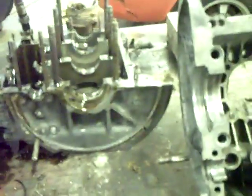Okay, we took the engine out. The engine was very difficult to disassemble. It had been together for so long that the heads were seized to the cylinders, or as we call them around here on Sand Mountain, jugs. But this is the cylinder that gave me so much trouble. This was number 3 cylinder, and as you can see, we had to beat it up pretty bad. It was seized up on the head, was right there, and as well in the case in this part too.